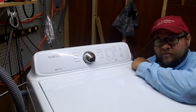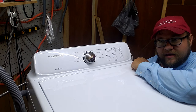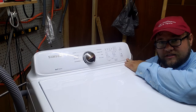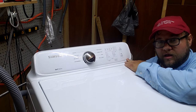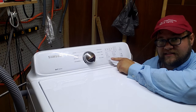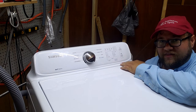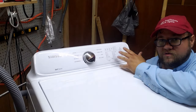Today in my washroom I have a Samsung WA40J3000AW that is not spinning. It works fine other than the fact it will not spin, and I want to try the diagnostic system to see what's going on. This type of washer from Samsung does have a very easy-to-access diagnostic system that is fairly robust once you understand what the lights mean. However, it's simple in that you don't get a lot of modes or special things — you get codes and that's more or less it.